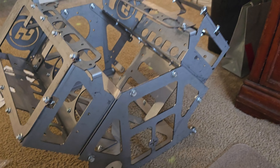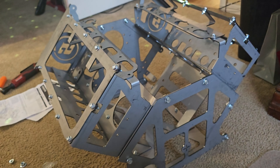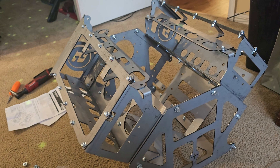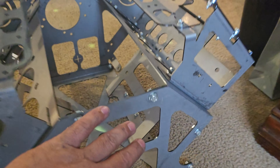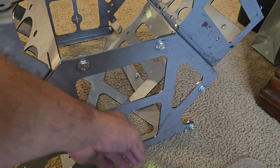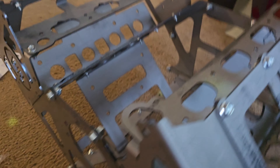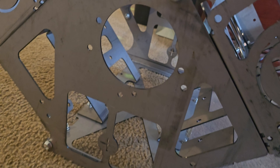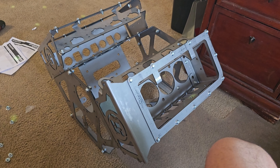This is a 40-pound template. The plan is I'm going to go over to the ZR1 and drop this in. I'll throw some clear coat on it just to prevent flash rust so that in the event I do swap future vehicles, I have the motor dimensions right here. You can see the crank centerline here, so you measure from there out — flywheel, balancer. You can actually bolt in a water pump. It has the bolt pattern for a timing cover, so the smart thing is to get a timing cover on it and measure how far the balancer sits and see how much room I have.